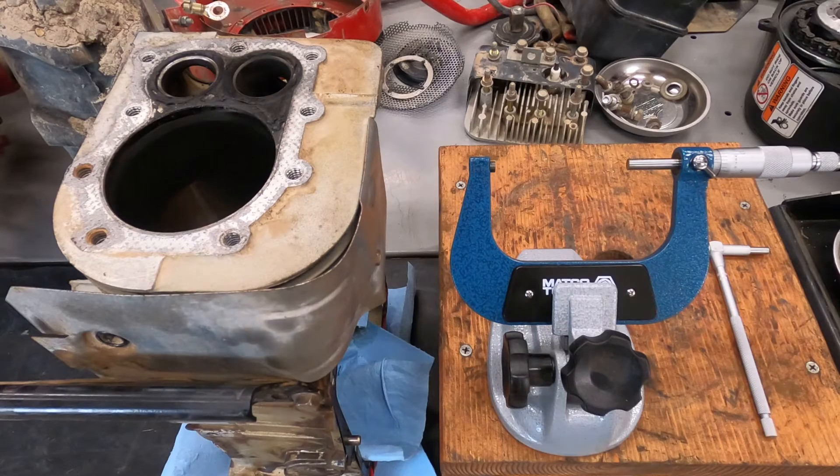One of the reasons we do this - it can save you a lot of money in parts. If you get a customer who brings you this engine, says they think it needs a new set of rings, you throw a new set of rings on, do a whole tear down, put it back on, and it's doing the same issues - that's a lot of wasted money in parts and labor. So while you've got it torn down, why not just do a couple of quick simple measurements, make sure it's all within spec and within the service limits.